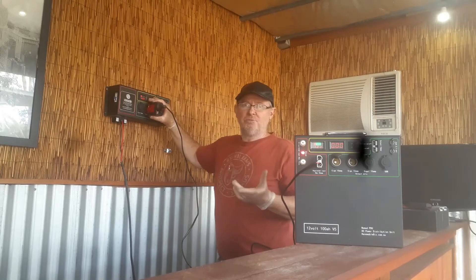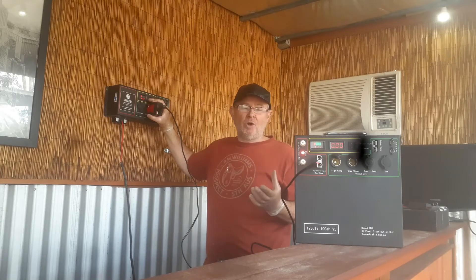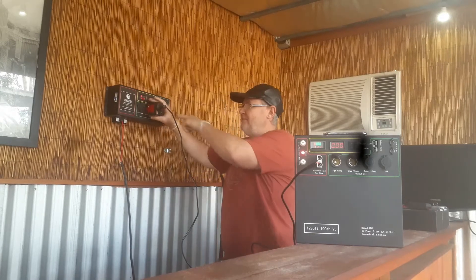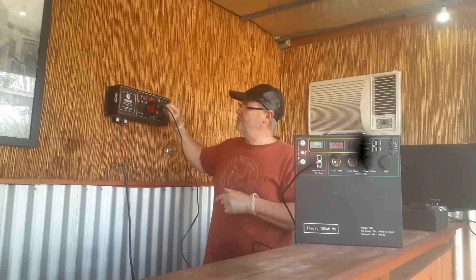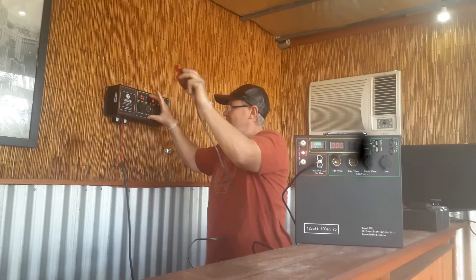Having a pocket inverter is a really good thing to have in the car. Run it for a couple of hours and put in, say, 20 amp — that's a lot of amperage when you consider a really good quality fridge probably draws around 20 amp-hour in a 24-hour period. But do not run them for 8, 12, or 24 hours. I've had customers running them 24/7 at campsites. There's a lot of dirty power and fluctuations out there, and a number of issues can cause these to fail if you load them to their max continually.